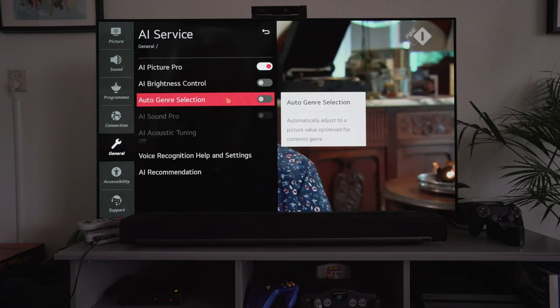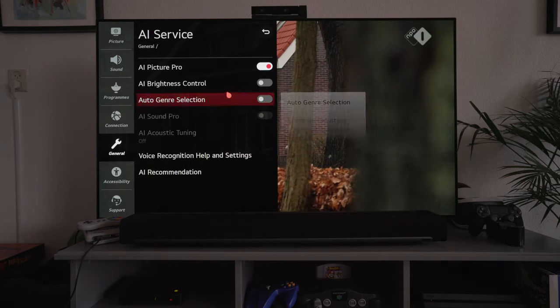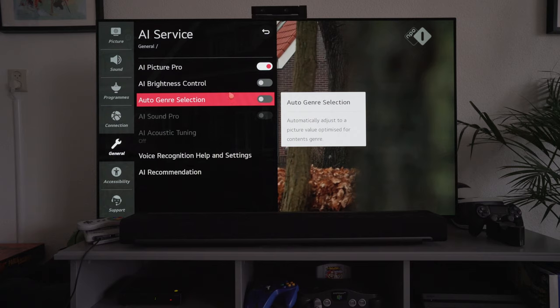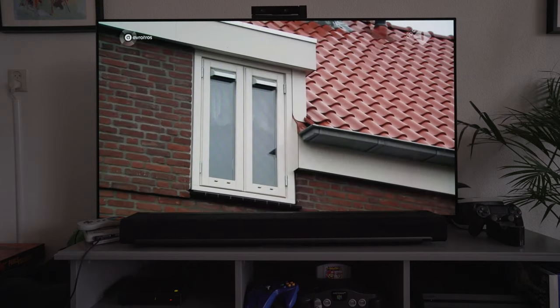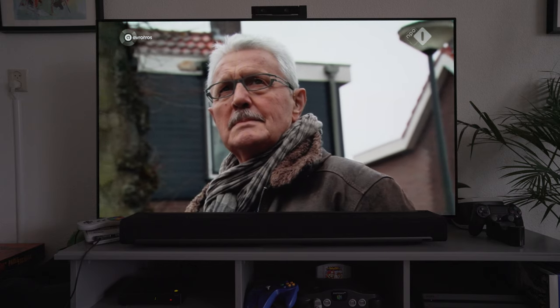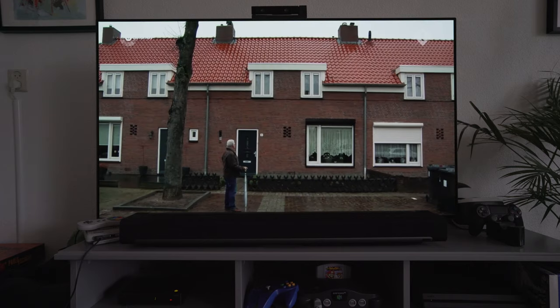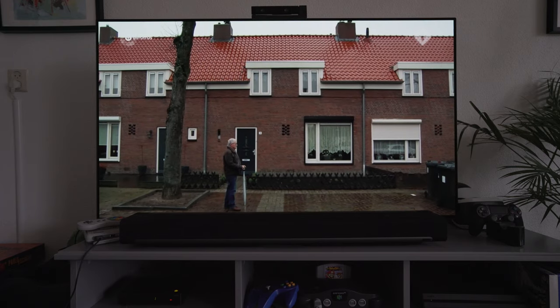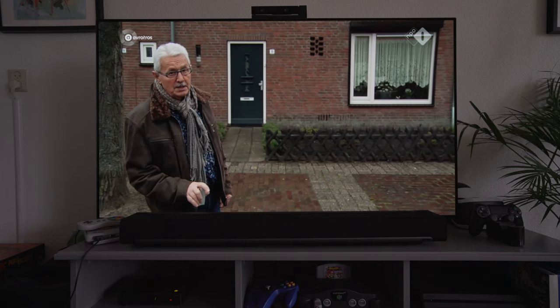For example, if I'm using Dolby HDR and I'm trying to use the cinema mode, then it will lock True Motion. True Motion is the system from LG that automatically puts frames in between your content to make it look more fluid. For sports, that's great. But it's something that gets locked in the cinema settings when you're watching cinema content, and I find that really detracts from the viewing experience. So by turning that off, you actually get more control over your system and you can change different little settings like the True Motion settings under Dolby for cinema. So this again is now using the upscaling.